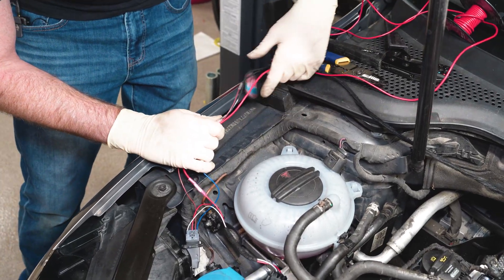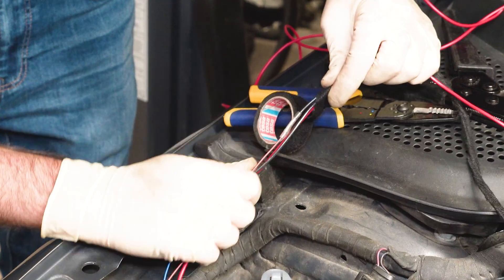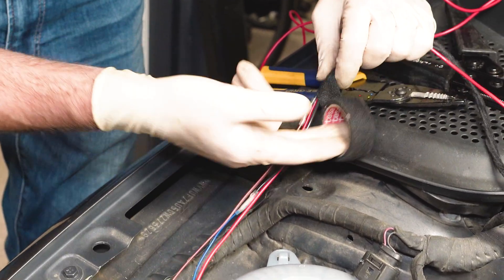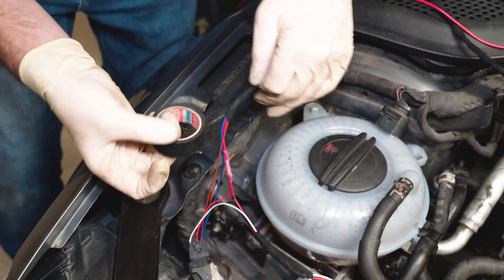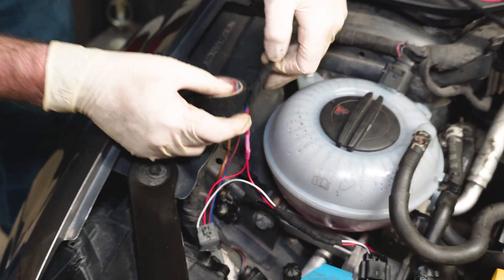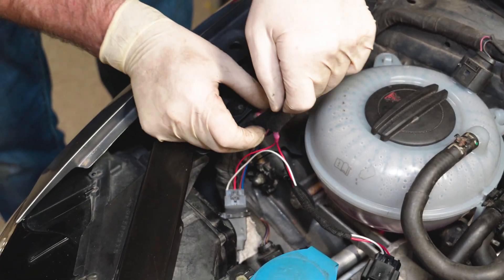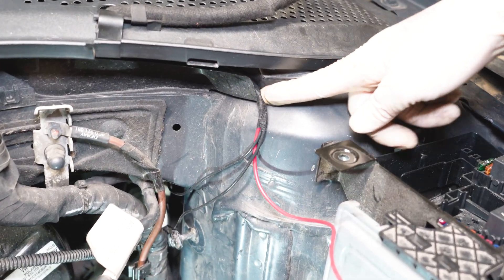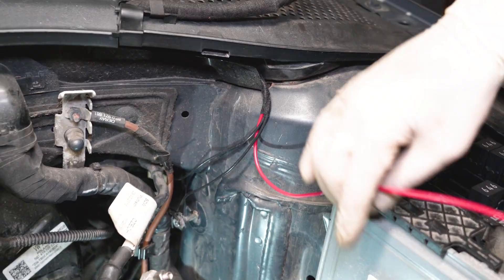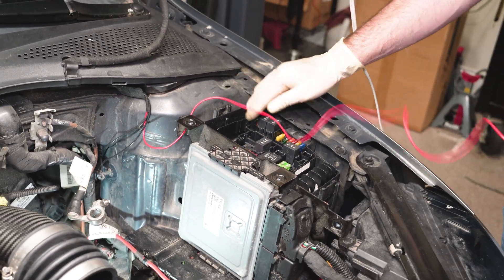I've been taping — I taped these wires up and I spliced the blue wire as well. I'm going to tape the red wire in too so it looks nice and clean. You do have to tape up your stuff so it looks professional instead of looking like a hobo was hired from the side of the road to do your wiring — it is advisable. So right here I ran it down from the cowl, these go into the body, and these are going to go right here to the fuse box.